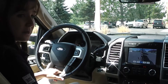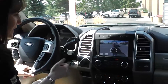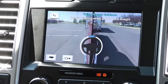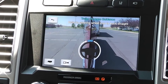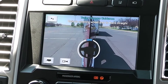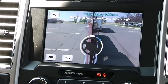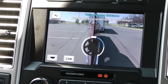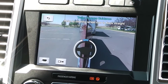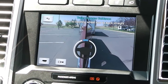There's one other really cool feature about trailer reverse guidance — we call it straight backup mode. If you press the steering wheel button on the lower left-hand corner, you get a big steering wheel in the middle of your screen with a little blue at the top, meaning you want your wheel centered. As you start to drift in one direction with your trailer, that wheel tells you which way to turn to straighten out. I'm going to cause myself to veer a little — now it's telling me to turn my wheel to the right, and now I center my wheel and I'm back on track.